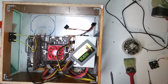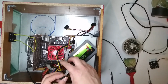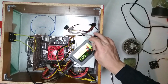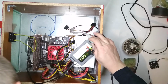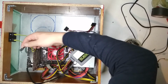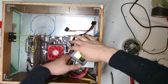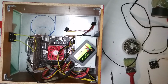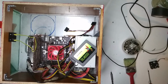All that remains is to wire it up, put in this front header, which is, where are the power switches and stuff? Yeah, wherever. That's the audio, USB, front panel, okay. And power, LED, whatever. Okay, that's where it goes. And you can only plug it in one way. Switch. That will switch on the computer when I press it. Okay. That's progress. And all that remains is to do the wiring, pull in the cables here and tie them down to these screws, and yeah, it's almost done.